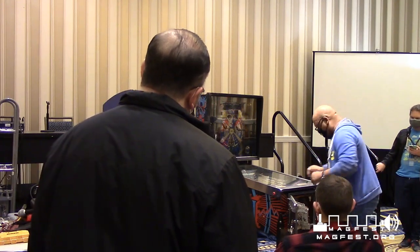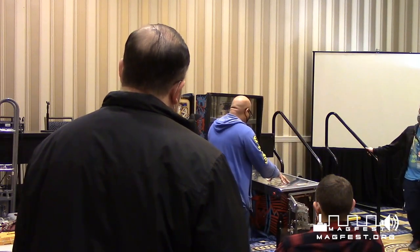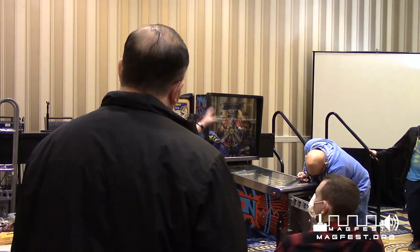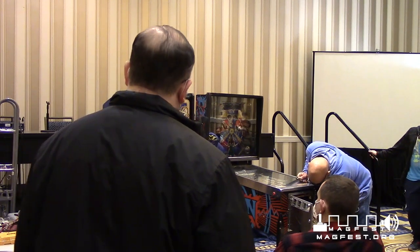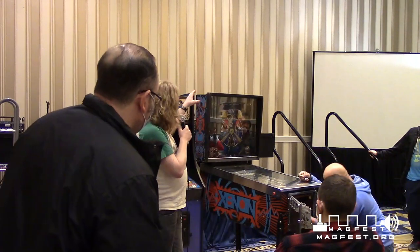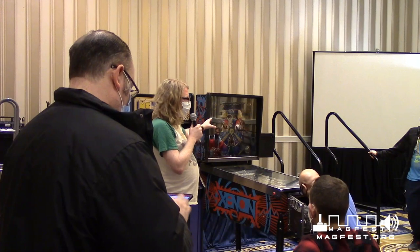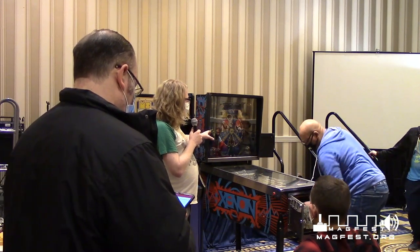All right, so pinball machines. You've got all the coils, all the lights. This is Xenon. All the electronics generally are in the back box. It will change depending on what era the game is from, but most of the time you have the high voltage in the base because that's the heavy part, and then you put the CPU board and everything up top. This game might actually have the transformer and everything in the top. I don't remember offhand.